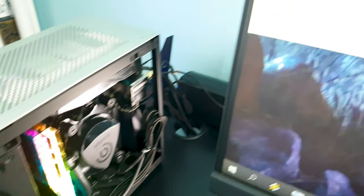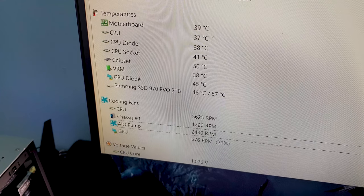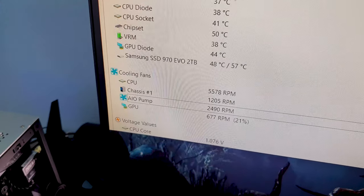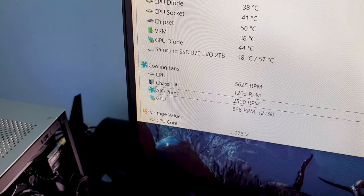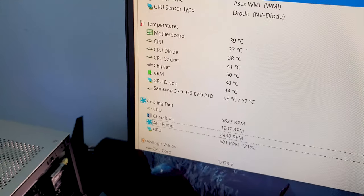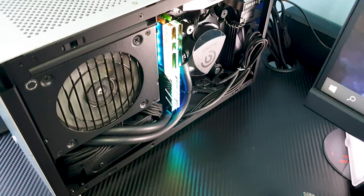When I switch the plugs, meaning I put the fan in the AIO port and then the 3-pin from the pump in the CPU fan, I got again the same exact numbers. So just divide that number by 2 to get the real reading. If you go to the website, you'll see that the max RPM for the Asetek 645LT is 2800 RPM. Also, this false reading is confirmed by Asetek as well.